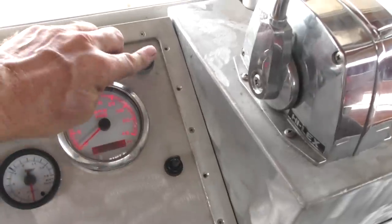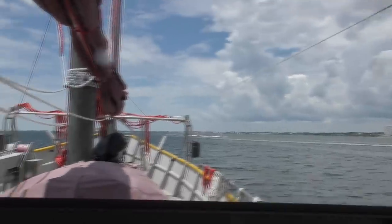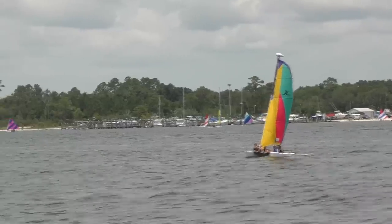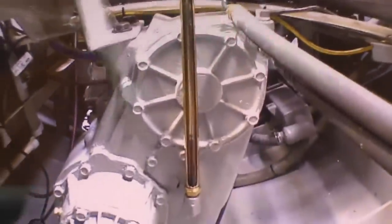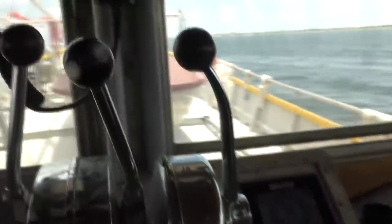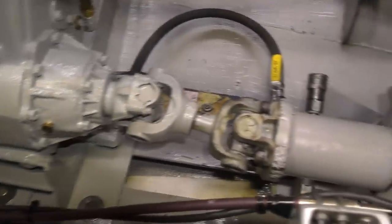Another test run — fuel on, engine on. So far she's doing really good. Man, there are a lot of boats out today. I think the Blue Angels are doing something — it's a non-stop stream of motorboats. Big Lagoon Yacht Club is holding sailing classes today. I think that's Pete coming out to say hello. All right, I tweaked the needle valve a little bit — it certainly makes a difference. I can mess with the pitch and the throttle and it doesn't seem to have more than a quarter inch effect on the oil level. The oil is perfect and the mount is in great shape with very little vibration. I think we got it.